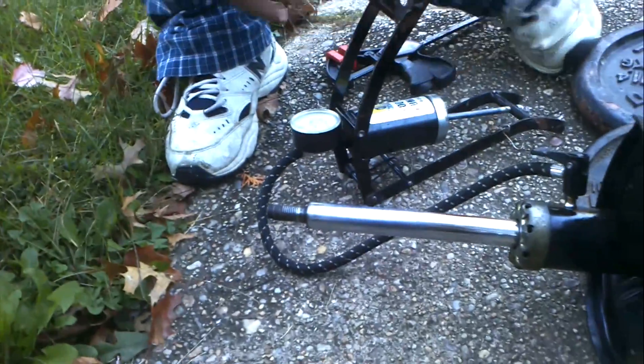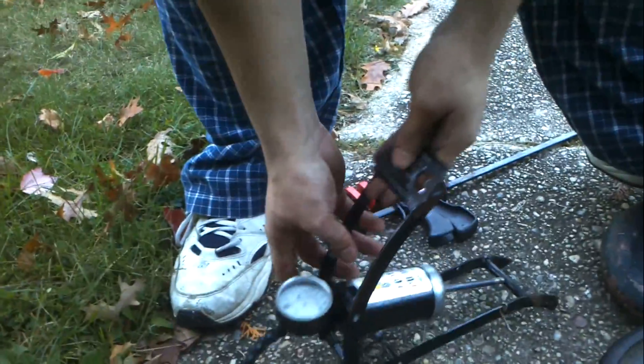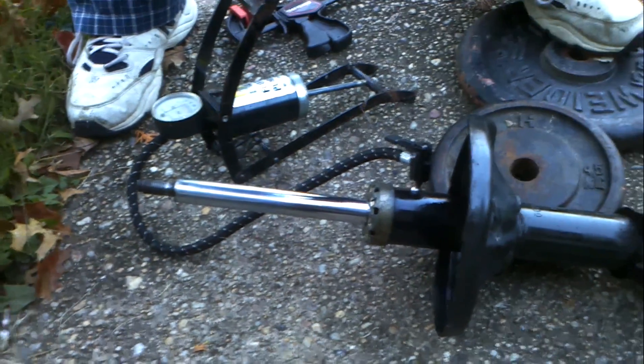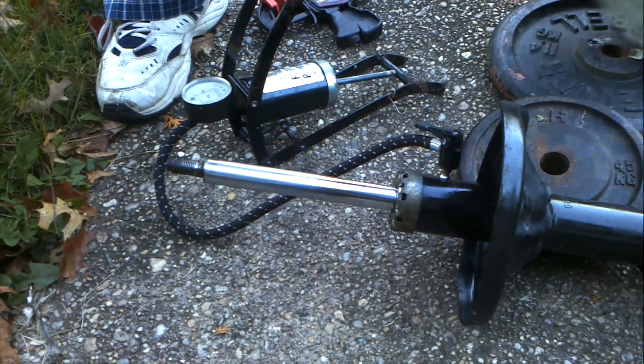So I'm going to give it one more pump. Now it is at 50 psi or so, fully extended. I'm going to go on the low side of what the factory shocks are filled with, just because these are old and I don't know whether the seals are going to blow out if I put any more pressure on it.